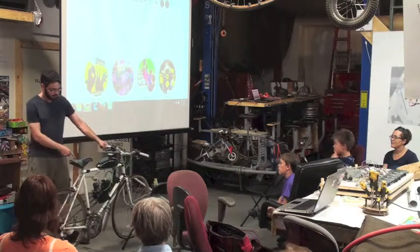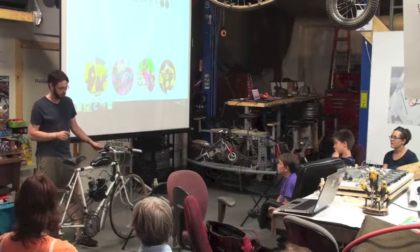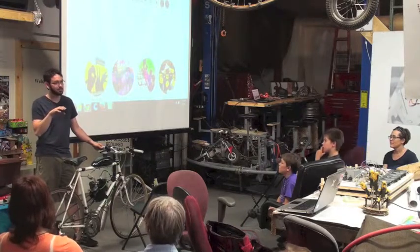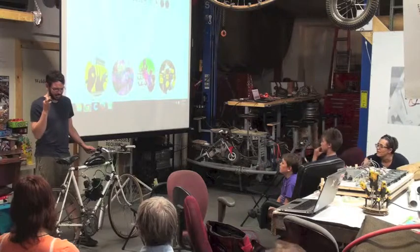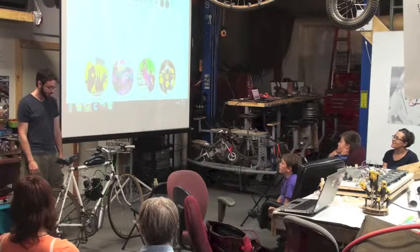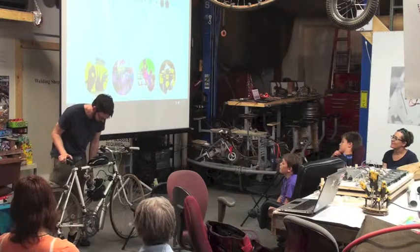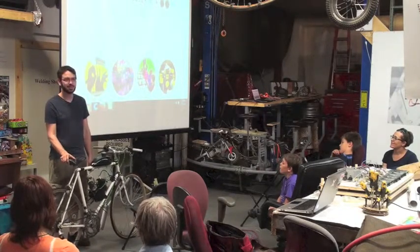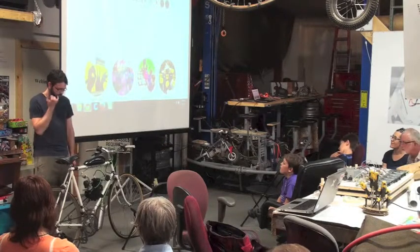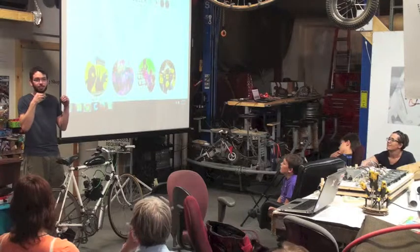The muffler actually works really well. There's this really high-pitched squeal that I got from the Chinese muffler, and when I just rode it around, it's like a really deep sound, instead of squealy. I wanted it to be less annoying when I was riding. How much does it weigh? All of it? The motor and the extra chain and sprocket and stuff like that probably weighs an extra 20 pounds or so. And I figured out the other day, all the Chinese parts are really poorly manufactured, so the nuts and bolts shake loose while you're riding.